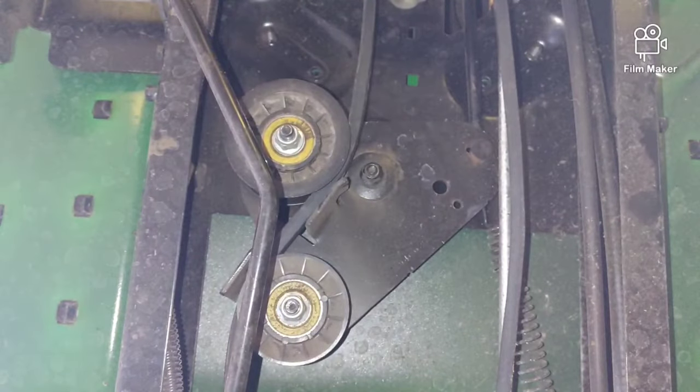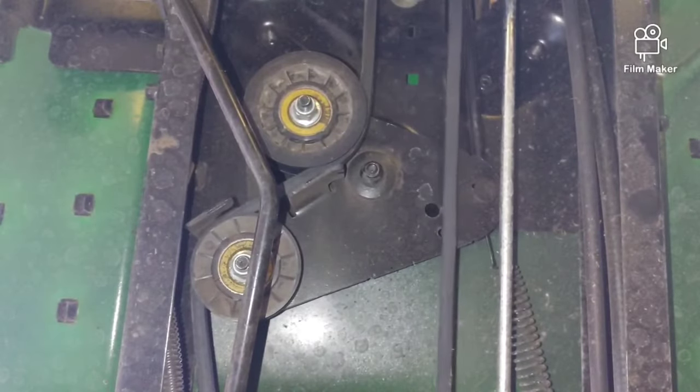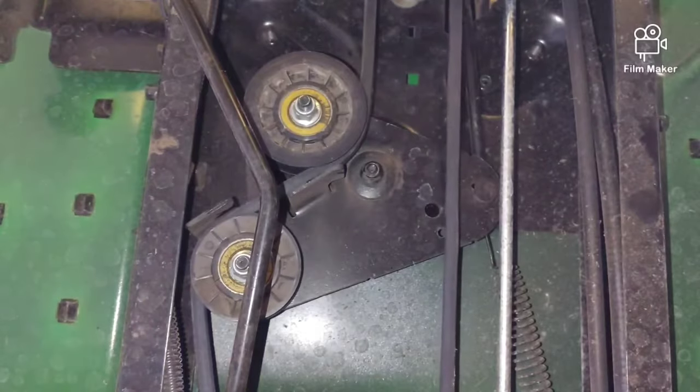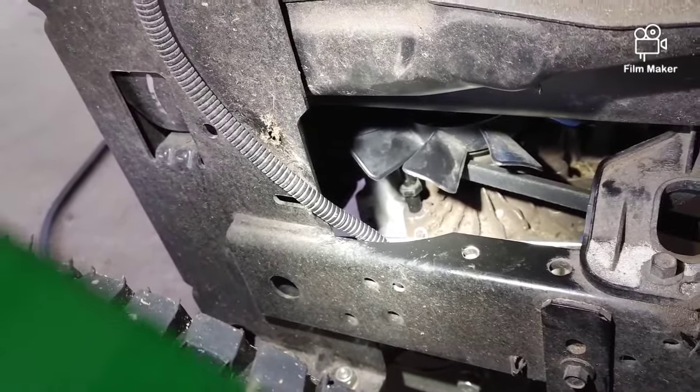I'm going to release the e-brake, and it's going to tighten up this belt, and then that way I don't have the belt in my way as much when I go to put that transmission stud, belt retainer stud, belt guide in there. Camera upside down for a moment. Let's flip it back over. Sorry about that. So there it is, got it started, got it down in there.